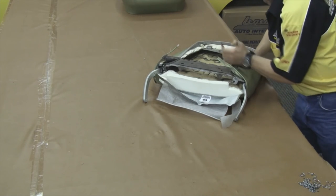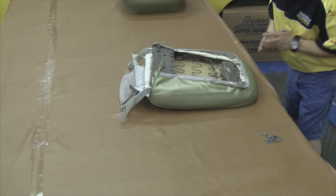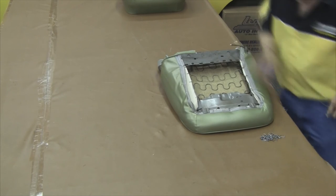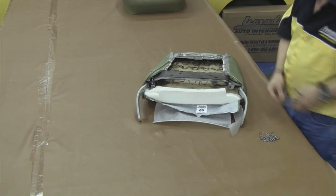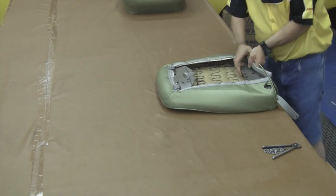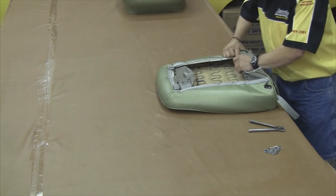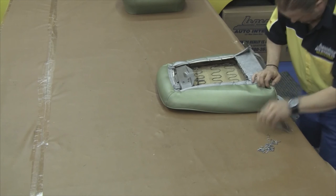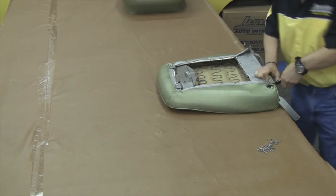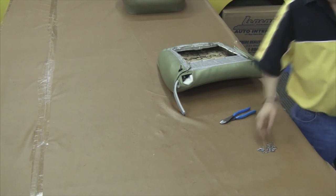The piping on the bottom edge needs to match or run parallel with the bottom edge of the seat frame. Then come up along the top edge, anchor the top edge, and finish with your sides. You can tell just by the sides — if you don't have any wrinkles in the vinyl, how your seat cover is going to look on the front side even before you flip it over. If it looks good on those sides, chances are it's going to look good on the front edge as well. Last, fold the bottom edge in between the posts, up over the top of the seat frame, anchor it to the seat frame, making sure the seat latch hole goes over the top of the post and gets hog ringed to the bottom edge of the seat frame. For any small details, tuck a piece of vinyl and put a hog ring through it so cosmetically it looks really nice.